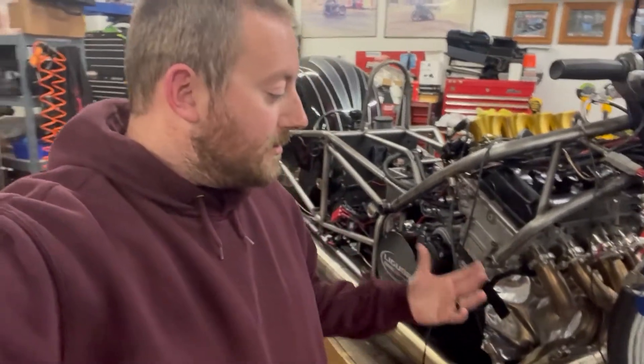I hope this video shows you how to check your timing and that you can apply what I'm saying. This is a Suzuki Hayabusa, but you can check timing on any bike the same way as long as you know where top dead center is. On a ZX-14, the case halves are the reference point for TDC — you have TDC 1 and 4. A ZX-14 is usually 118 degrees crank index position, but it could be off due to a slightly twisted crank. If you're off five degrees on your crank index position, your whole timing map is five degrees off from what you think it is. The spark plug will tell the story of where your timing actually is — I always say check your spark plugs to see where your timing is at.